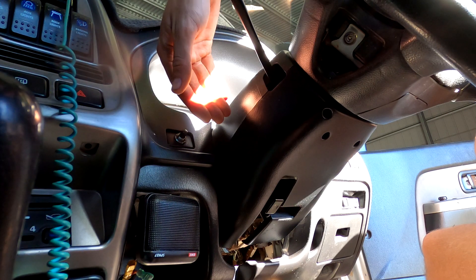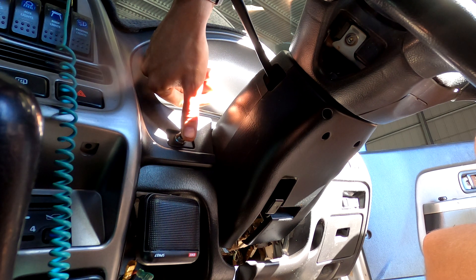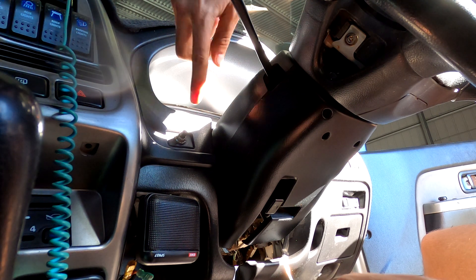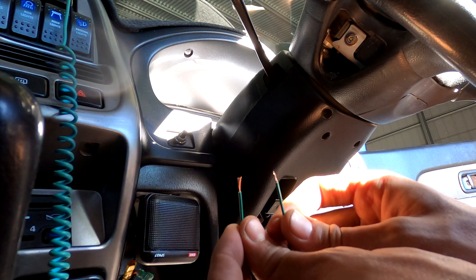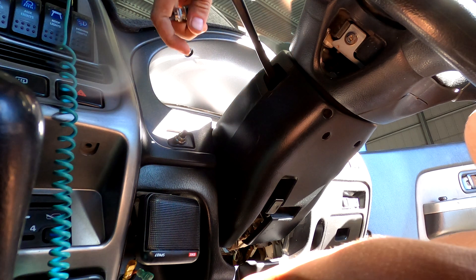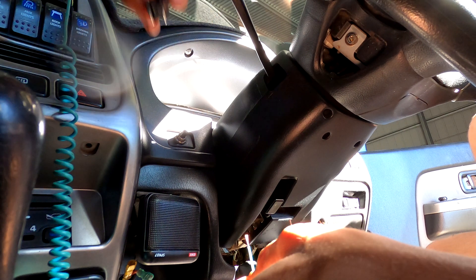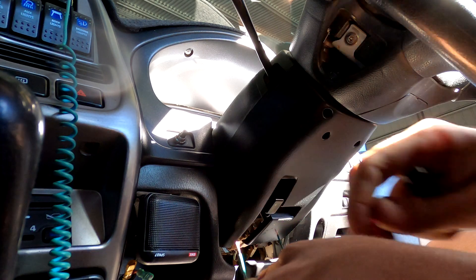Alright, so I'm not sure if you guys can see, but right here I have a switch — that activates the solenoid to my secondary battery. I'm going to put the glow plug switch right beside it. Here we have the wires. I'm going to mount the switch right here beside this solenoid for my dual battery. It's got two terminals on the back — we're going to use these right onto here with a little bit of heat shrink.